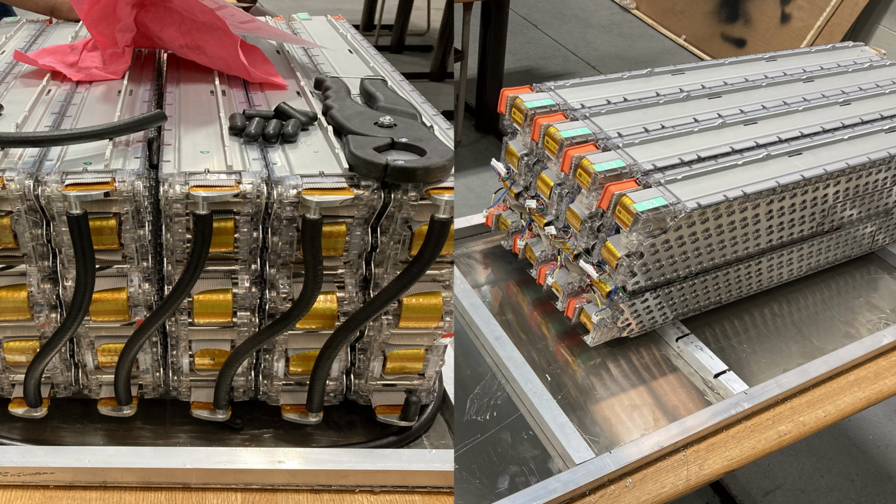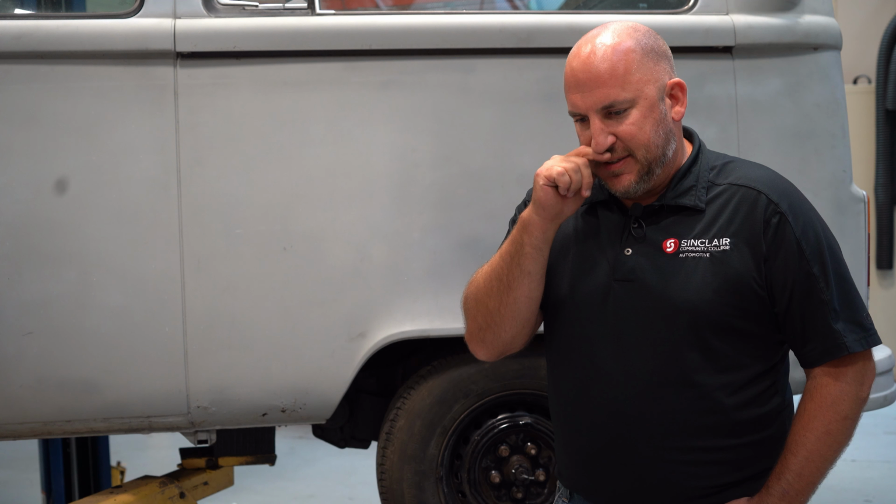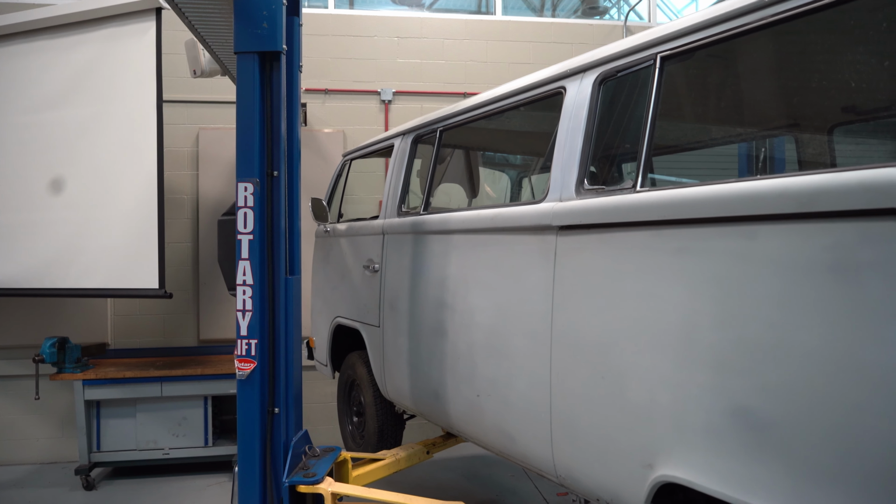So we built on some of the basics of what our OEM existing vehicles are. So in the class, we'd still talk about hybrid batteries or high-voltage batteries, and we work on the bus, we're actually trying to assemble high-voltage batteries and basically adapting them to work for what we're doing. And then I'd say some of the other stuff that was not even remotely related to the fact that it's an electric car is there's some fabrication of items that just would be mundane in most circumstances. Things like we need to make a new bracket for the throttle pedal, the accelerator pedal, just because it's used from a different vehicle and it didn't come from a 75 bus. So just little things like that are basically outside the realm of a normal automotive class, but I think those are the things that they really learned a lot of stuff on.